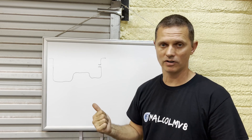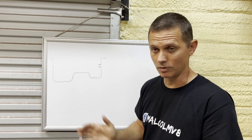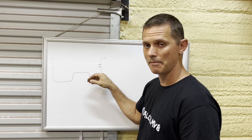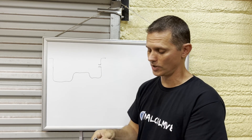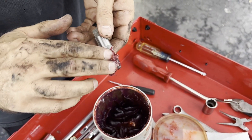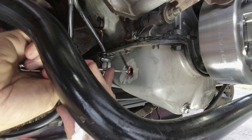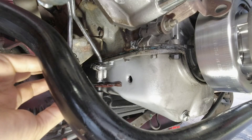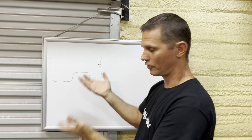It's a little sketchy but a lot of people do it and it does work. It's not my favorite - if this pan ever comes out we'll rip that out and weld something in - but to get us going right now in a semi-reliable manner, this is going to do it. The nice thing about not drilling is we're not going to get a bunch of metal shavings inside the pan. When tapping and cutting threads there's always a chance for shavings, so we're going to pack this thing full of grease - that'll attract any shavings and cause them to stick. Then we'll use a magnet to clean up the hole, and as a final safety measure we'll drain the oil and flush some oil through the new line.